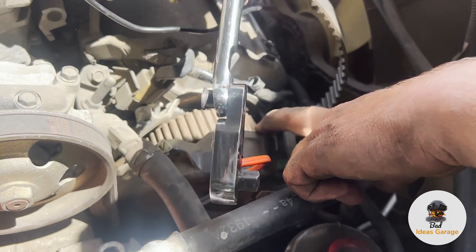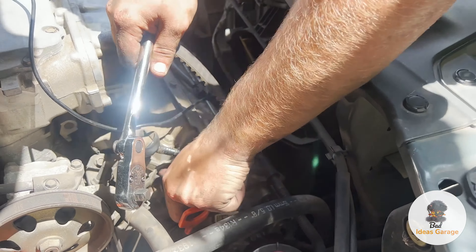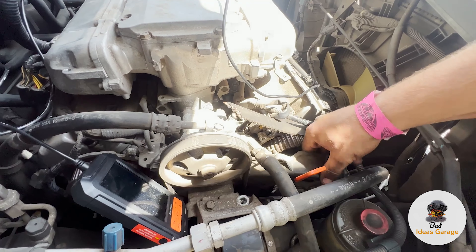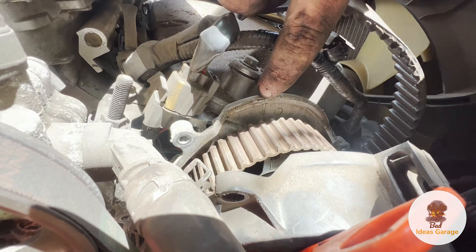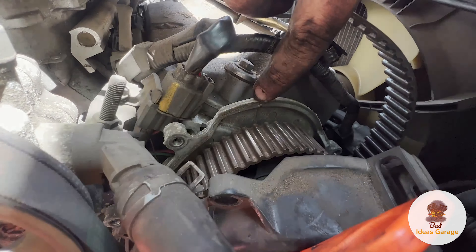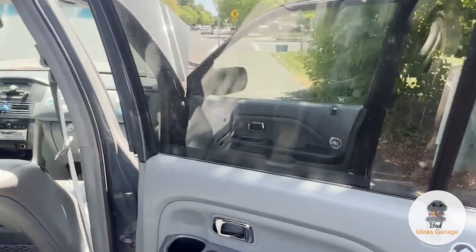What I'd like to do is take this cover off and see if the belt is still on it, still being held by the tensioner. What I've seen before is belts break on the bottom and both cams get held by the tensioner right in the perfect spot. Alright — I found it. We found some belt. Well, there's your problem. It's just kind of — but if I'm not mistaken, it's on. That means that one probably at least held. Damn, there were two of them. Or just keep losing bolts and they keep hitting the bottom. I think the timing mark is pretty dang close. That timing mark is good there.